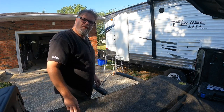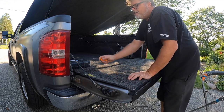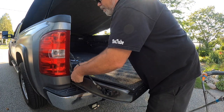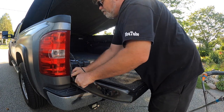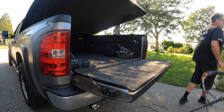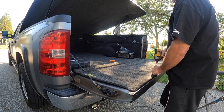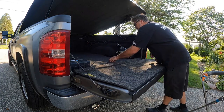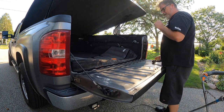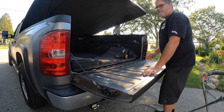We're going to pull these wires off and see if we can get this tailgate off. When you're pulling the tailgate off, the first thing you want to do is unhook the tailgate assist. By the way, tailgate assist - if you need one, glass accessories. We're going to take these self-tappers out - I don't use velcro anymore, I just use self-tappers. Get them out of the way.